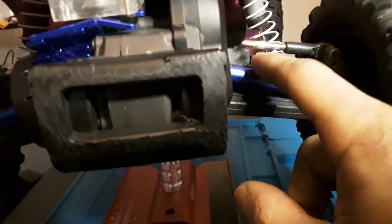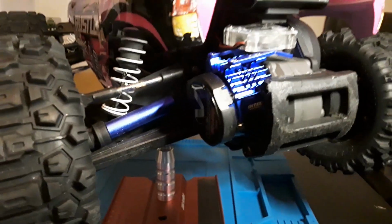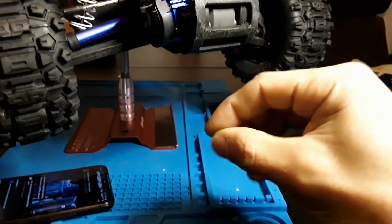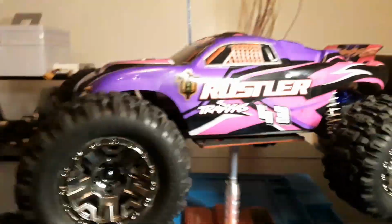This thing is ripping, still running 18/86 gears. Now be careful of running in snow, because you're going to get rust in certain spots down in your nuts and bolts. So what I do, if I run in something like snow, is take my Rust-Oleum gel spray, spray it in a cup, take some Q-tips, dab it down in there, and then dab all the heads of my screws inside. If I take this thing apart, you may still see some rust spots in there.